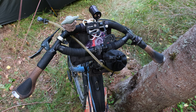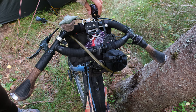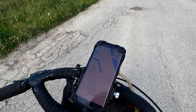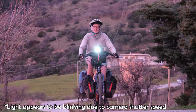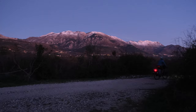We have Jones H-bar handlebars with Ergon grips that help a lot with wrist pain and numbness. We have the Sine Wave Cycles Beacon as our headlamp, which is plugged into the dynamo. It has a light switch and a USB charger, as well as a plug that you can connect to an external battery if you're going really slow uphill, so you still have a light if you're not generating electricity. The only downside is that the beam is basically shaped like a flashlight, which is technically illegal in Germany. Our dynamo setup allows us to slowly charge a power bank or our phones while riding.